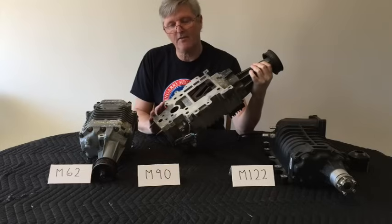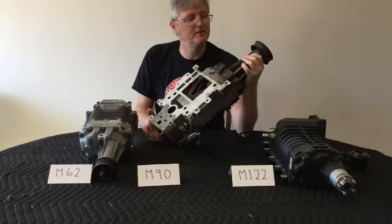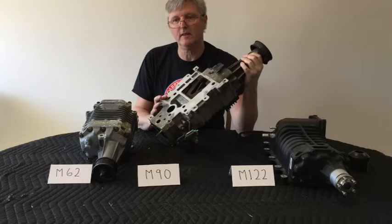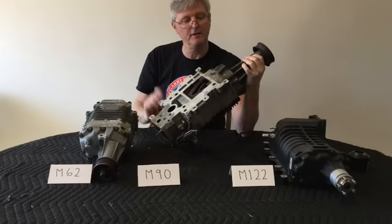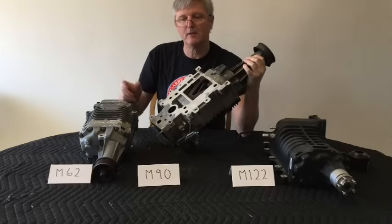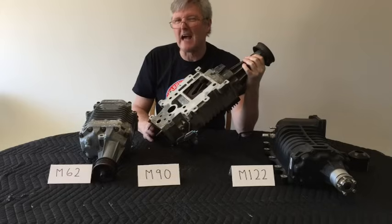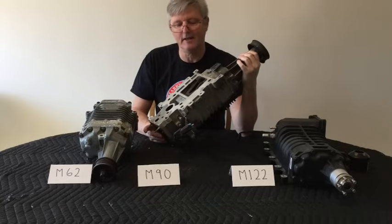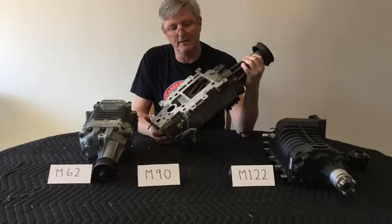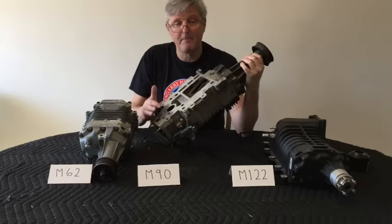What you'll find — and this happens on my car — is that when the car is idling and not under boost, there will be a certain amount of pulsing from the intake that affects the supercharger. Because there's a series of spur gears inside, it causes those spur gears to rattle back and forth on their backlash, making a kind of clattering sound. It goes away as soon as you touch the throttle. It only happens at idle, it's a known thing, it doesn't hurt the car or supercharger — and that's why they put the bypass valve on there.